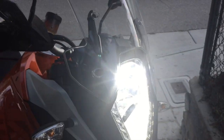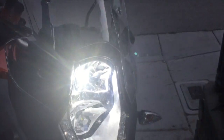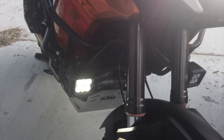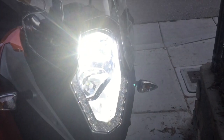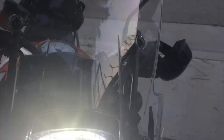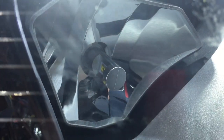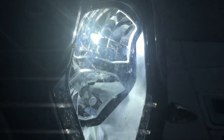So after I connected with the wiring diagram you just saw, as you see here, I have low beam on, and as you see at the bottom, the small 18 watt LED light on one side, because that's connected with the low beam. And once you turn your high beam on, since on these KTMs, when you turn on the high beam, your low beam always stays on. Now I have high and low beam on, and the small lights also on. And that's how you install 110 watt LED in KTM. Thank you for watching.